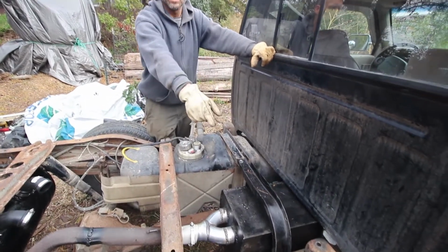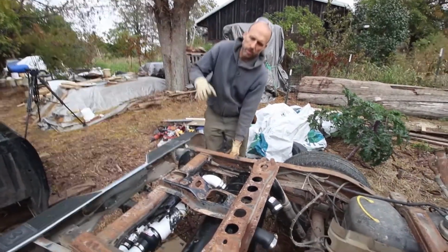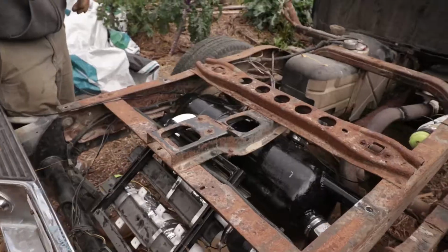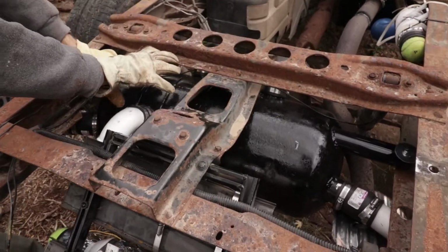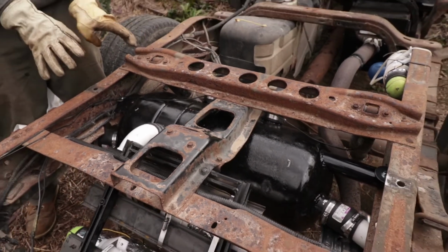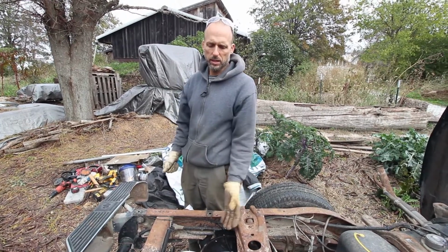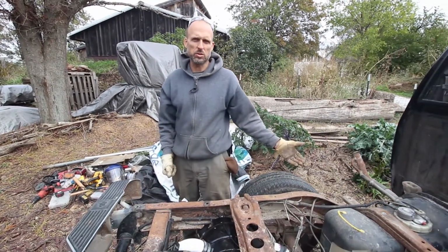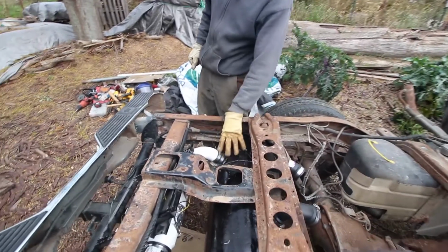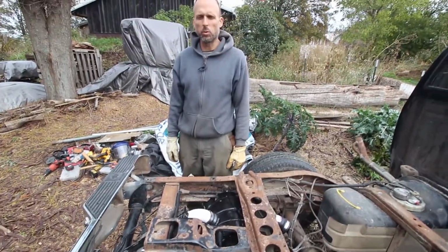The gas later in the system gets plumbed to the back corner of the truck bed, goes down, and on either side of this tank here in the middle, the cooled gas from the gasifier comes down in two different pipes and enters this tank. This tank collects moisture, that is condensate, that's a byproduct of the wood gasification process. All wood contains some amount of moisture, so this is a way to collect it and store it before it gets passed on to the engine, which obviously doesn't want any water in it. This is also a place to collect tar, which is another byproduct, a solid, tar-like substance from the wood gasification process.